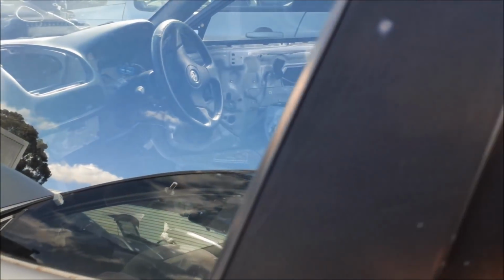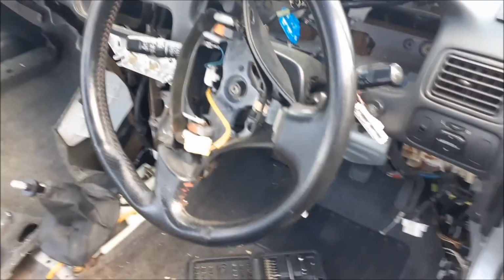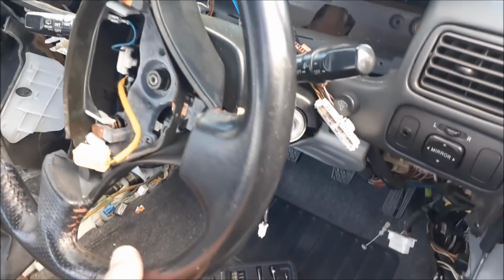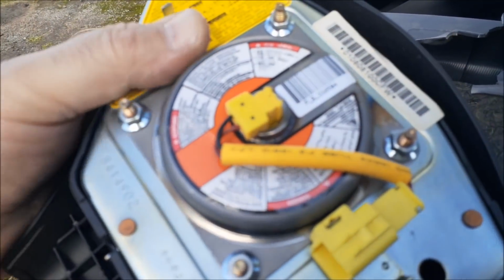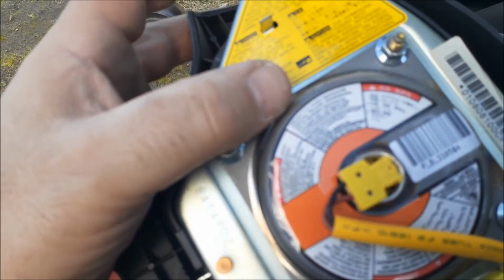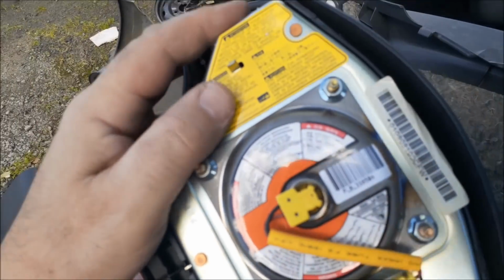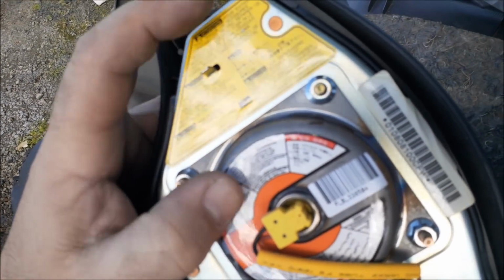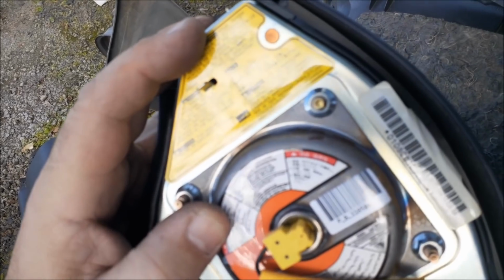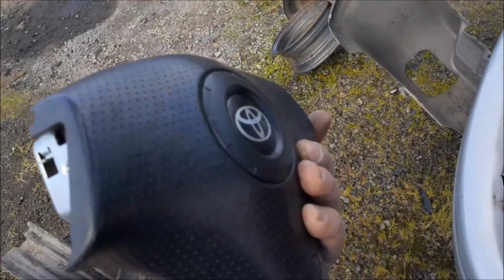What sort of, what's that thing called? The airbag. Quite a nice wheel. It'd be great on a Starlet. It's the Sportivo, the Turbo and Levin wheel. I pulled this off. This looks like a bloody Takata, but these don't come up on the list. And I had a good look, and it's got all the right markings on it for a Takata, although it says somewhere something alternative to that. Where did I see it? Struth. Oh yeah, there it is. In that little bit there, it says Hearst Inflation Systems USA. So that is safer. That's why these cars didn't come up on that list.